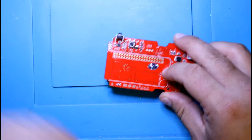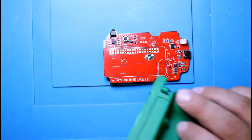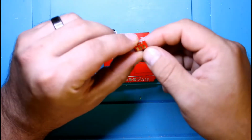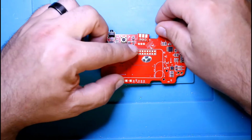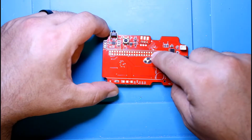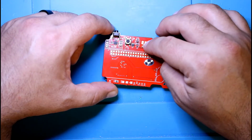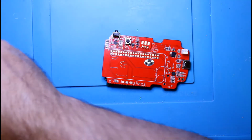So, turn on my soldering iron real quick. Get the board I showed off earlier, which is this little thing right here. So basically the 3 holes line up with these pads, almost like the similar type of soldering here with the GPIO on the Raspberry Pi to these pads here. So these are going to act as anchor points as well. So I'm going to line it up, and then I'm going to put some solder in there.